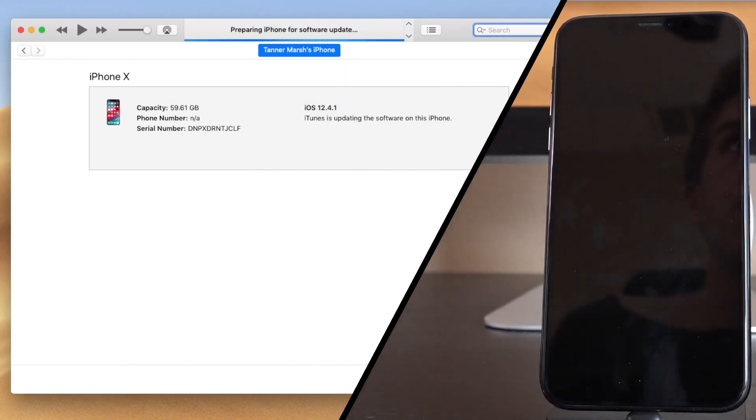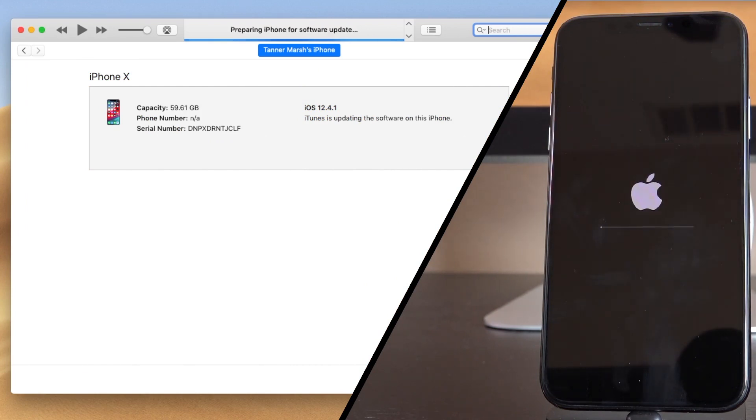So at this point I've already sped it up so you can see the general stages it goes through. After it's extracted, it's going to prepare your device for a restore after you enter your device's passcode. And then it's going to enter recovery mode and go through the software update process. All of your data will be maintained, and really the main progress bar to go by is the one on your device itself, since the one inside of iTunes is only relevant to the specific step or stage the downgrade process is actually on.